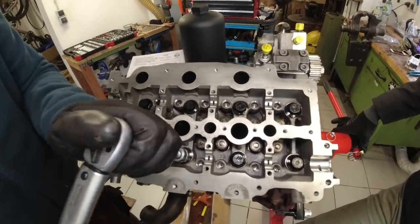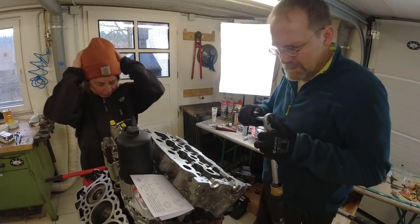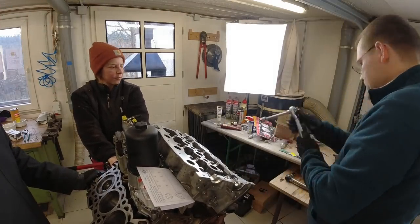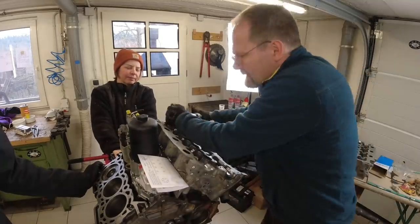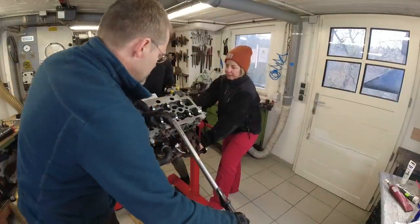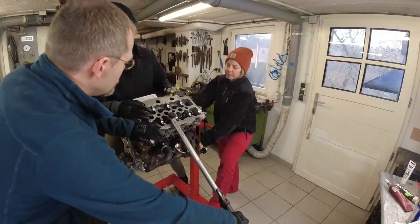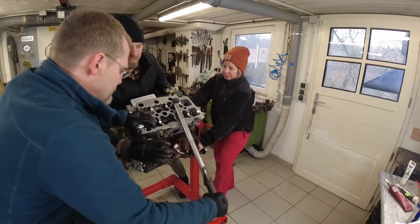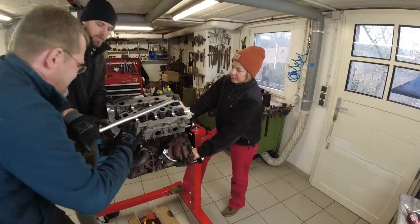First go around is 20, so this is number 1. So I got 40 adjusted here on this torque wrench. Now the next one is 80. So this one is 180 degrees with a maximum of 230 Newton meters. I'm gonna start it and then we both pull it to 180. One. That was not too easy. And the thing moved. Two. Stop. Four. There. Good. Done. Gotta be clean.